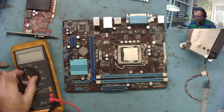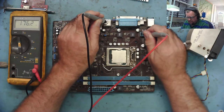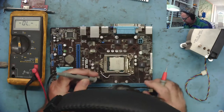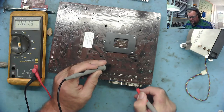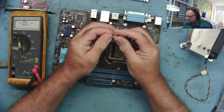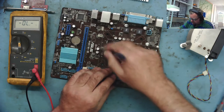The lady told me it was working — let's see how she knows that. CPU's in. From 12 volts on the VRM we should see a high resistance — yeah, high resistance. Otherwise we would have seen the resistance of the CPU through to ground, so there's no high side short. We can also check the low side — probably easiest to go from one of the coils to ground. That's reading quite low — I'm guessing that's the resistance of the CPU.